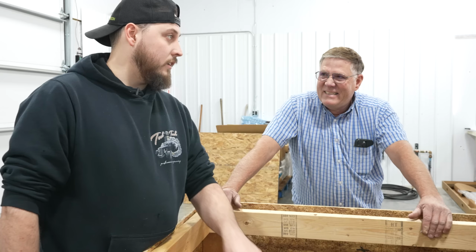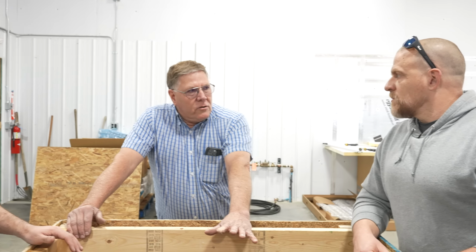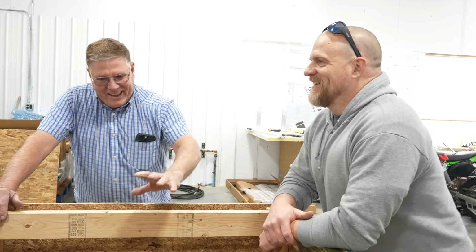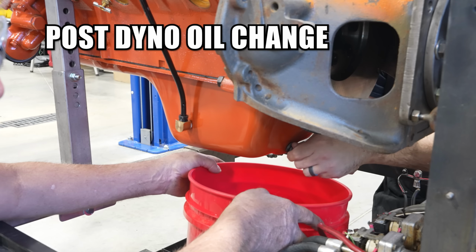We do have a new oil and a new filter in here that we want you to run for 500-ish miles, and then change that oil. It's in there already. It has break-in oil in it again. Theoretically, this thing is fully broken in at this point. We ran break-in oil in it, drained it out, and put that oil in my motor, just because we're cheap on my own stuff. And then you have new oil and filter back in here now, ready to go again, 500 miles. You know you're going to drop that plug in.